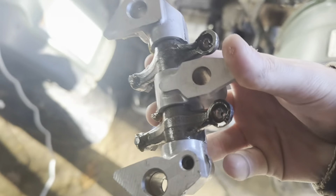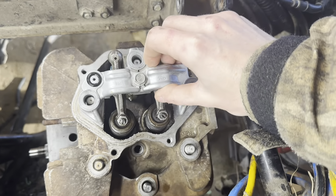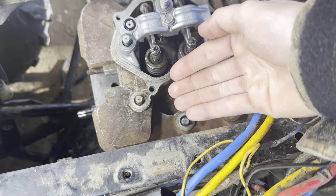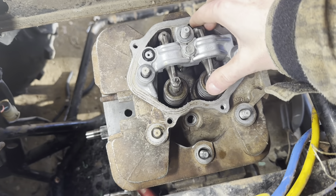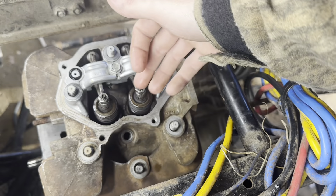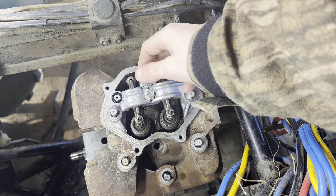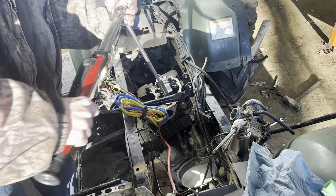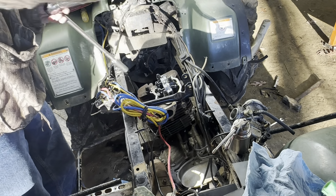Take your cleaned rocker cover and lay it on. As you spin it around, watch your intake valve — as soon as the intake valve goes down, look for that piston to come up. As soon as it gets to the top, drop that on there. You should have just a little bit of play in your valves — that's all you're looking for. That way when you torque these down, the valves don't interfere. Put some lube on all the threads, put the washers on, torque it to 29 foot-pounds. The case is cleaned out real good, all the gasket scraped — ready to put back.